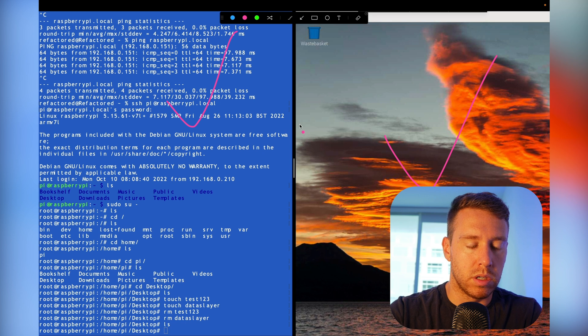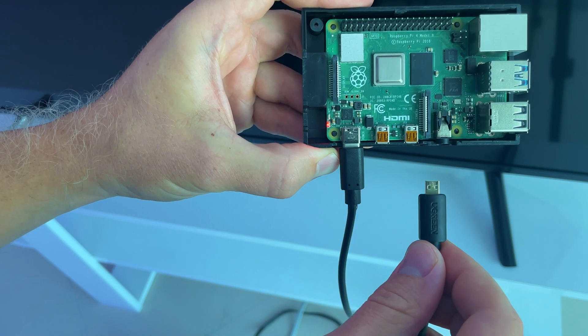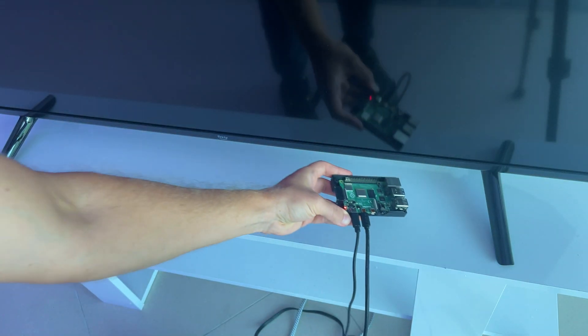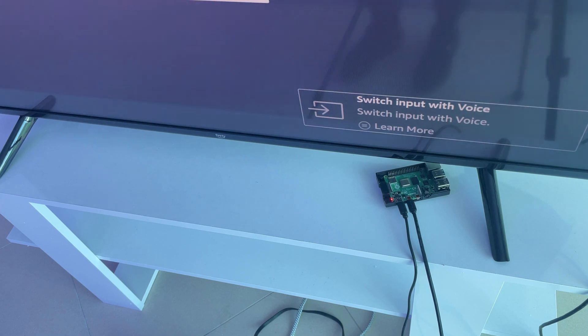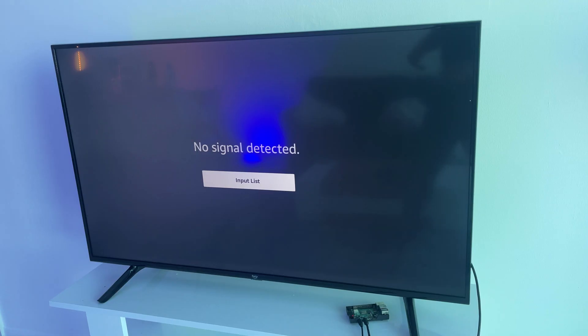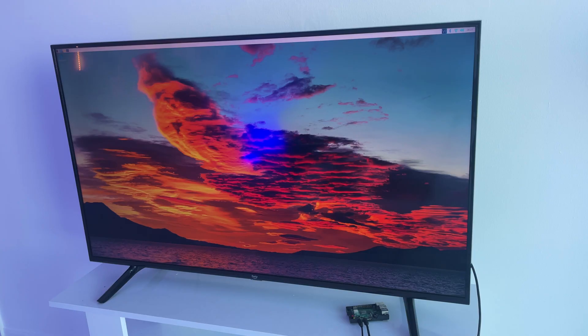The final way to connect is to just physically connect your device to a monitor, keyboard, and mouse. I'll connect into the mini HDMI port here and then connect this to my monitor. You might need to reboot the Raspberry Pi for a hot connection like that to work, so I'm going to reboot from my computer over here. And there it goes — that's the easiest way to do it, with just real peripheral devices, and then it's like an authentic computer.